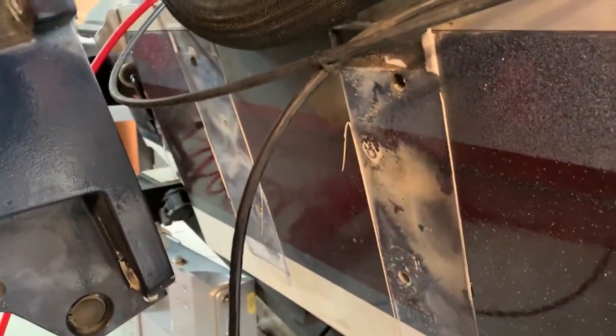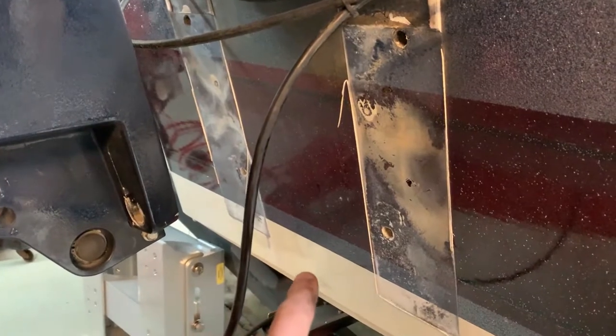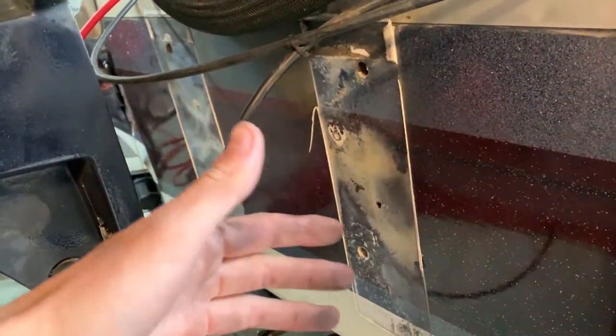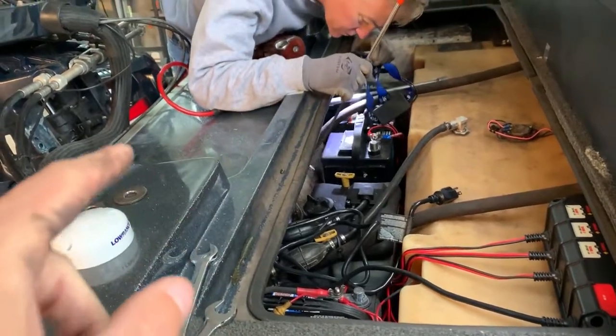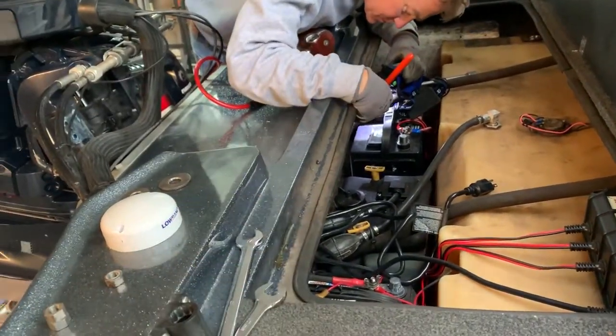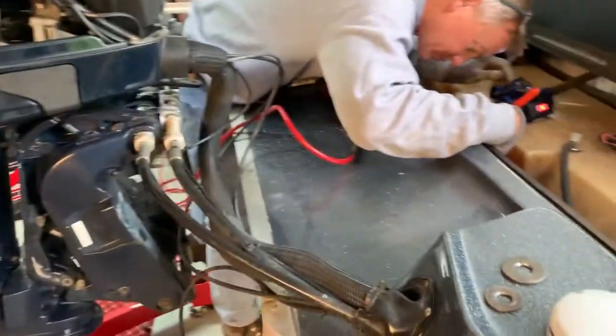A little update — we just got the rest of the jack plate off the boat. Very simple. It's held on by four bolts, two on either side. You basically need two people for this: one's going to be holding or undoing the bolts on this side while somebody else is in the back compartment. There's one steel plate down there and another steel plate further up with the bolt holes. Somebody needs to be in there holding those down. One thing to note on these Dynatrack boats: there are two nuts on the inside of each bolt in the back compartment. Generally it was best to get that outside nut off and then the second inner nut off — that made things go a lot easier.